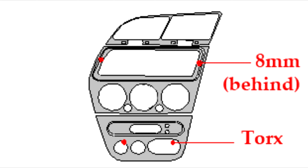Alright, so what we're going to do now is remove the lower part. Now, the proper technique is to take your spatula and squeeze it into these little gaps here. The best way you can do it is by pressing the upper fascia panel and trying to create a gap. I'll see if I can do it now. So, slot that in somehow.